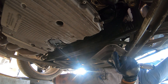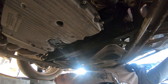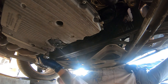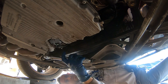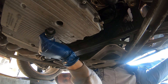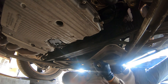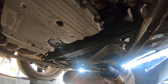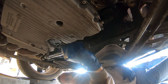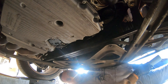Done draining. Ready for 444 inch-pounds on the drain plug, or 37 foot-pounds. Get that spun on there. It does feel tight going on because it has to crush that new crush washer. Just make sure you do the proper torques.